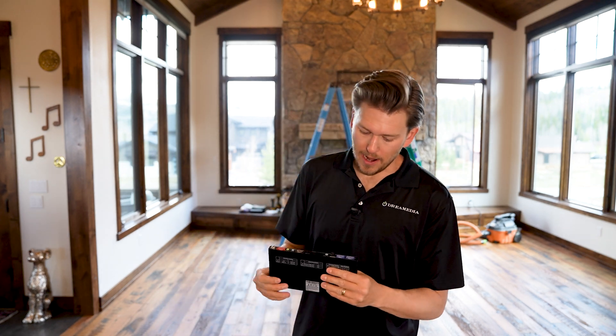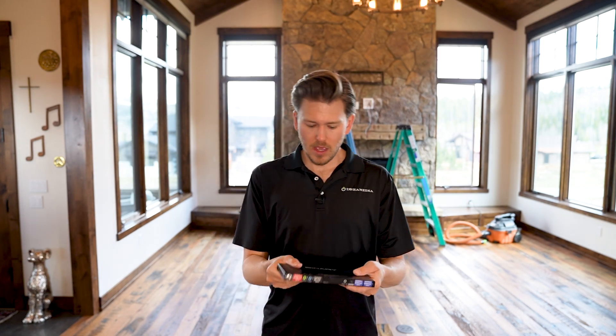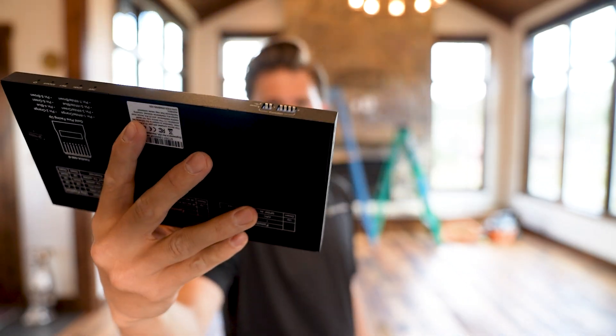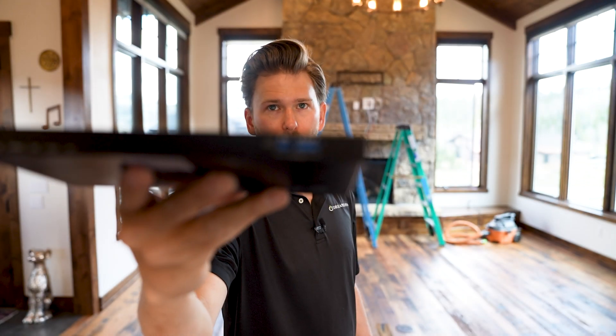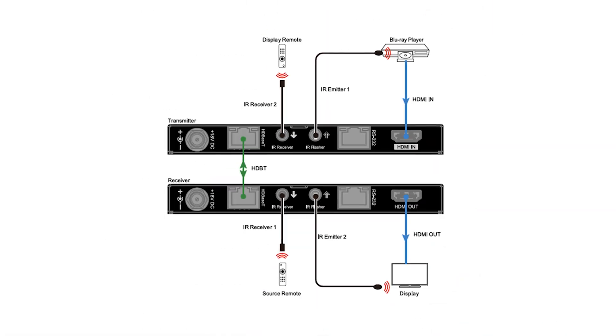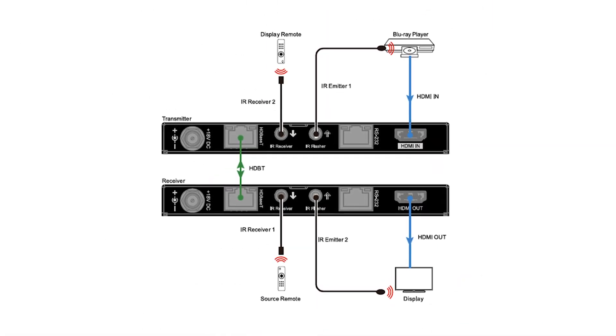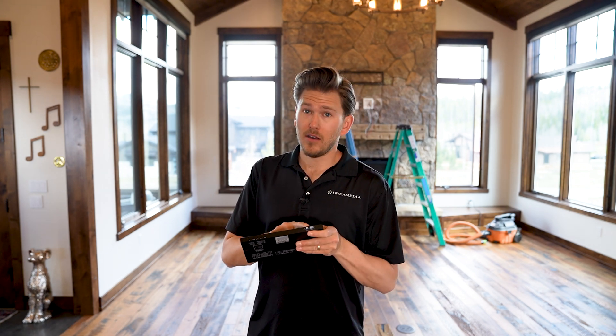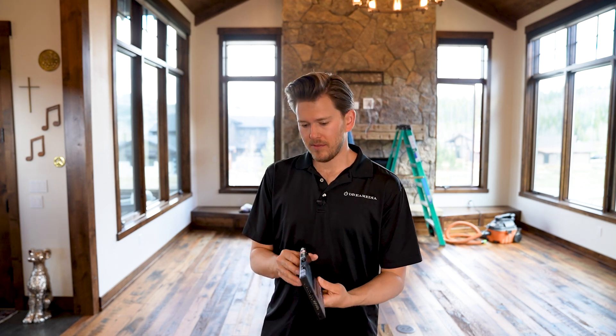For guys that don't do this all the time, there are a bunch of dip switches and this can get you in trouble. See these dip switches right there? They all have to be set according to the specifications of your video output for your receiver and your television. If your video settings aren't right, you can get flicker, weird things going on, or no video signal at all. Just be aware that you do need to set your dip switches properly depending on the video resolution.